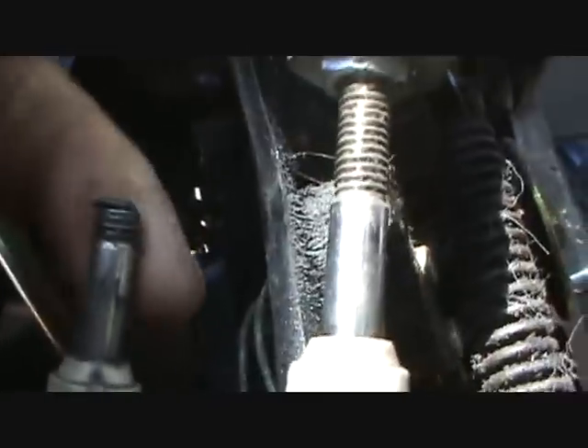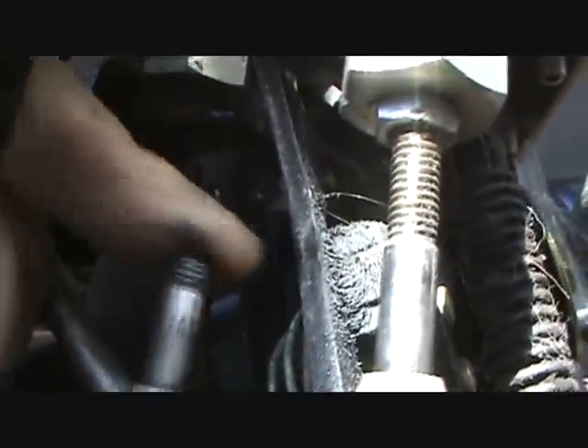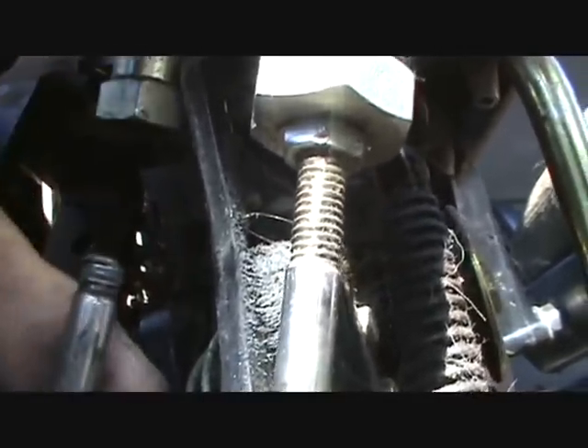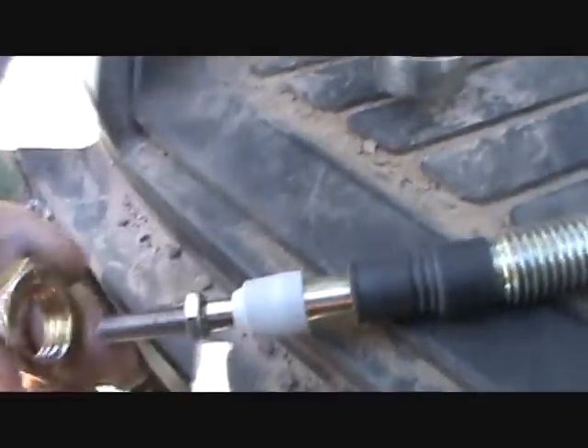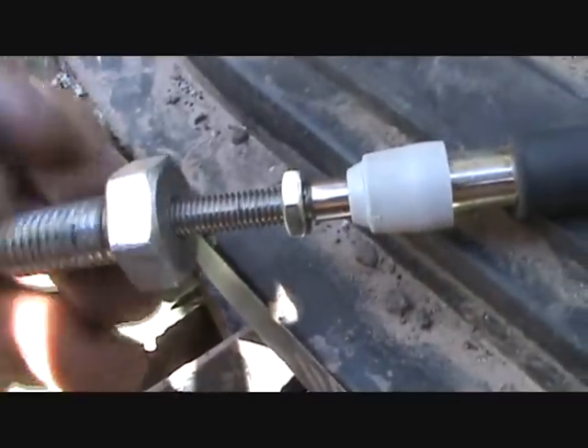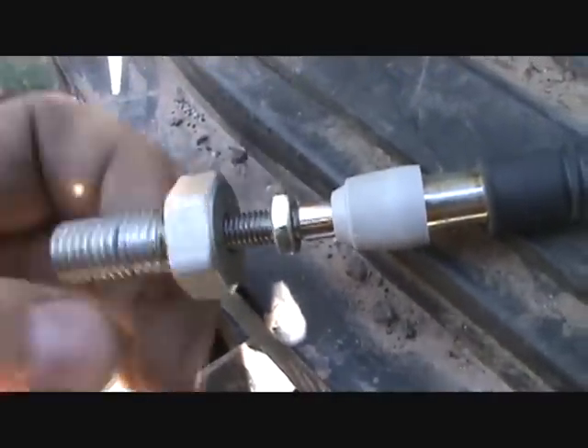I figured out what the heck is wrong with the shifter here. You see that thing going up and down there? My brother-in-law did a little bit of repair while I was away — Dad was plowing his driveway, so he had to help somehow. He re-threaded the cable that got busted off. Now that cable's junk, but we're in luck. About two years ago I bought a brand new cable because I had lost one already. When he threaded it in there, he kind of buggered the threads, so I had to run a chaser down in there and get them straightened out so this thing would actually go in and out the way it's supposed to.